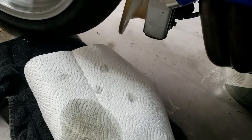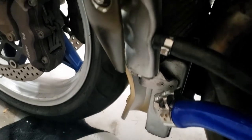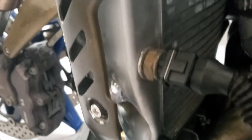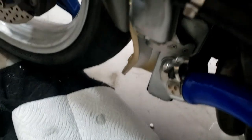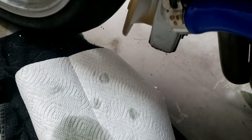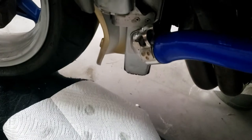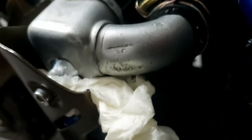Not the most sophisticated method of diagnosis, but a very effective one. I have been trying to locate the leak. Having established I think it's one of the mounts for my guard, I put a bit of kitchen towel at the bottom one, and that certainly stopped any leaks. But then I moved it out a bit so it wasn't up against the guard, and we got more leaks — those three spots there. Then I moved out to the top and pushed it in right up to the edge. That seems to have stemmed the flow downwards. So I think it's that top mount. That's the leak.